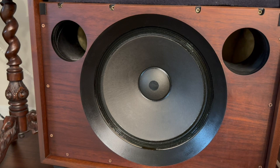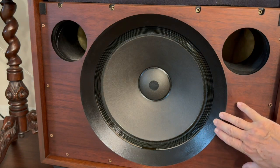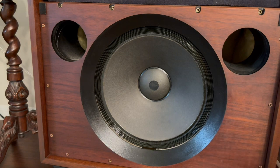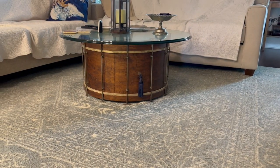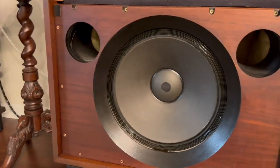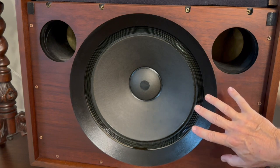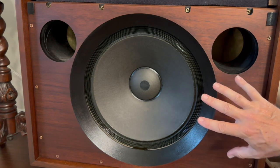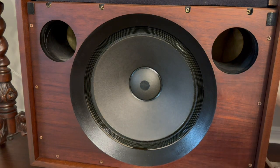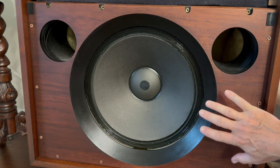It's up to each manufacturer — they may put the speaker behind the baffle, which is kind of old technology today, or they may put the speaker in front of the baffle, and we see a lot of that. When they put the speaker in front of the baffle, like Wilson for example, they will put foam or felt around their bass speakers to stop reflection — just like with this big drum. All you have to do is hit that drum and then go play your stereo and see if that bass sounds like when you hit that drum. That drum isn't super, super deep, but it is very accurate, and that is what you're looking for. That's why manufacturers are doing this — for soundstaging and to increase the accuracy of the bass coming off the speaker.